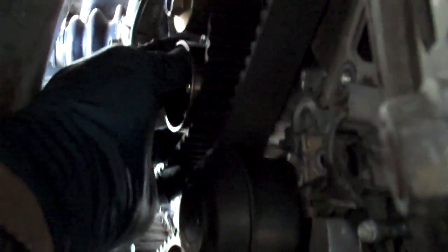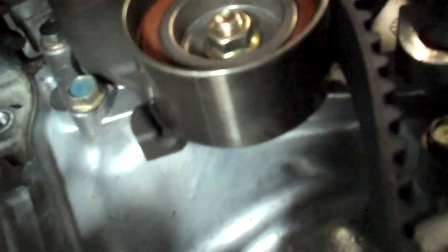Now all the marks are on, and all the slack is where the tensioner is on this back side. So I pull this tight and it'll kind of stay. I'll get it out of the way so I can put the tensioner in. Take the two bolts, little 10mm head ones, and I'll take this down underneath. Ka-ping! And I'll install it up in there. You can see those two bolt holes are where it goes, and that's a little foot that the tensioner pushes on. Load it up, put it on, pull the pin.